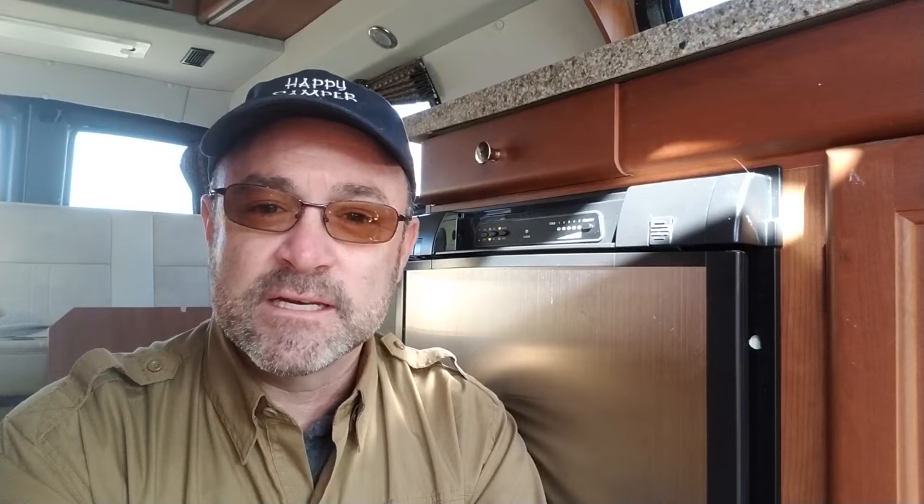In this instance, the customer said his refrigerator is too cold — he had been playing with the dial value but didn't know about the slider on the inside. The slider: up is colder, down is warmer — his was probably all the way up. If you really want to troubleshoot, take the thermistor and just hang it loose. That puts the refrigerator effectively in bypass mode — it's not reading the fin temperature at all and will go into Arctic mode. If it won't go into Arctic mode, we have some problems: could be a bad heating element, low gas pressure, or a seal leak. On your Norcold, you'll get a NOCO code — I've got a whole video on what that NOCO means.